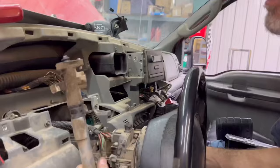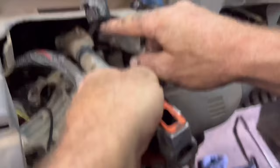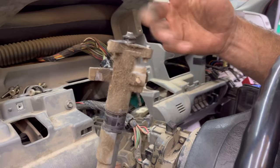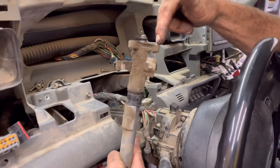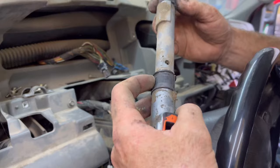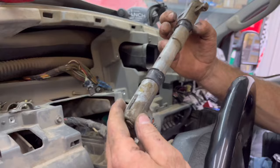So we got pretty deep in the steering column — broken bolts, this goes all the way back with the shift lever on it. It's real common for these to get loose, sometimes they'll actually fall out — sometimes they'll actually break too. But if they break, most of the time you can get down there with a T30 on the back and tighten these bolts up, and that'll give your shifter a little more stability. He had one broken cap — we got a used cap and put it on that side. We put one bushing on here, a used one. We should have some new bushings — for about 50 bucks you can get a new shift lever, new pin, and basically get your shifter solid again.